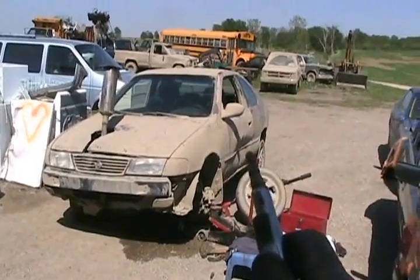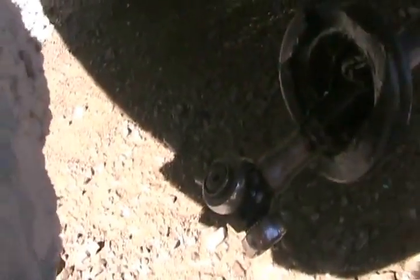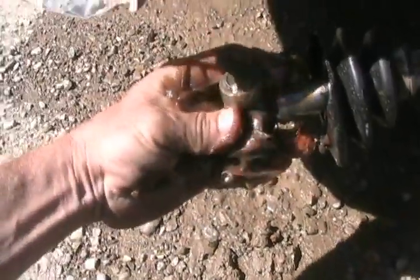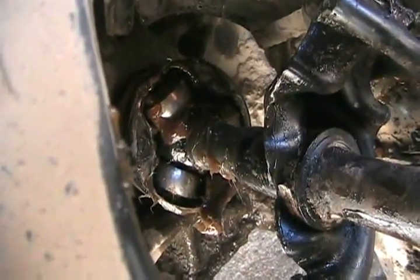Well, I do have to blow the water out of those needle bearings first, so it doesn't displace the grease. Good enough. Now the dirty job. Someone's got to do it. Yuck. I felt slimier, if you know what I mean. Good enough. Now some for the pocket. Get her in there. I'm just straining my arm getting in that tight space, that's all. Now ball joints back in. And the part is riding deep enough into the pocket that it won't pop itself out again.